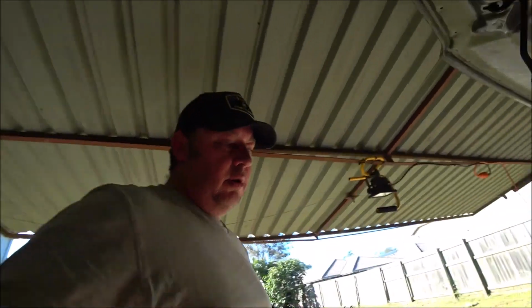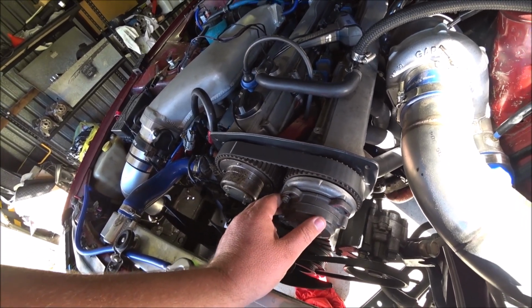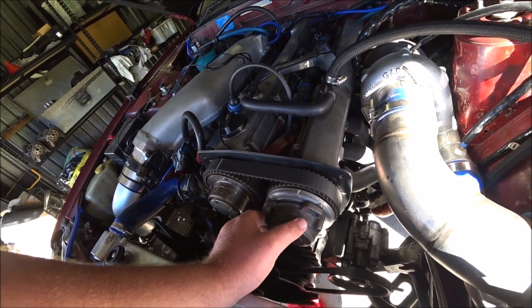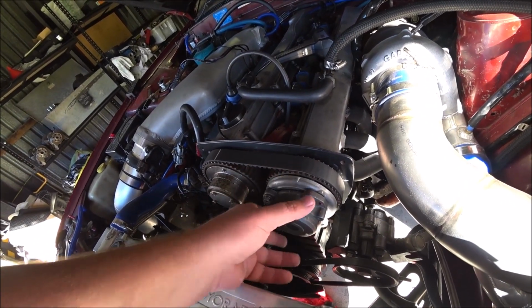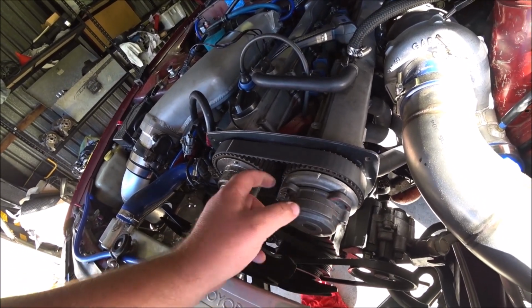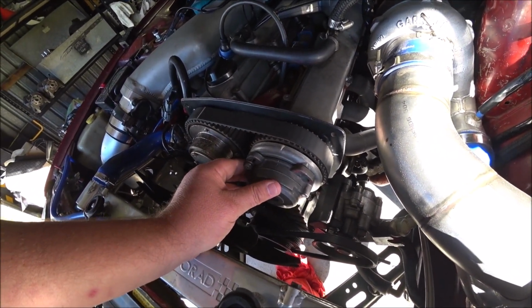The mark where it was, pretty much hard over, is 10 degrees, which is where we want it. But while it's running, it's rotating over. I suppose just the force of the actual cam turning around in there, shaking it. This is because we don't have the cover on, so we don't have a load against it. So I might try and find some washers to put in here so I can lock the timing hard where I want it and see if that fixes it.